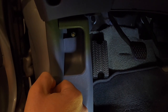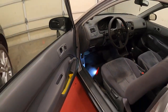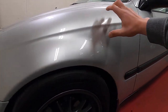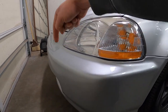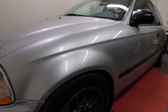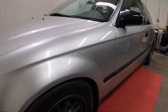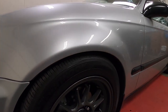I have another one on order from Honda — they're roughly about $20. I'm hoping I only have to remove this little panel to access where it mounts. If I can get the car up on a lift, I'll have access to the fender liner, and if I remove that, I should be able to access everything up here. I'll have to remove the bumper, which isn't difficult — it just kind of snakes behind the headlight and wraps around to the latch apparatus. I'm trying to avoid removing the fender and going the least intrusive way by going through the fender liner.